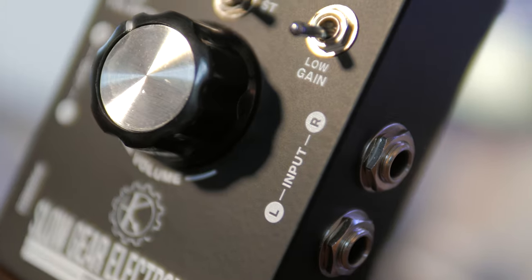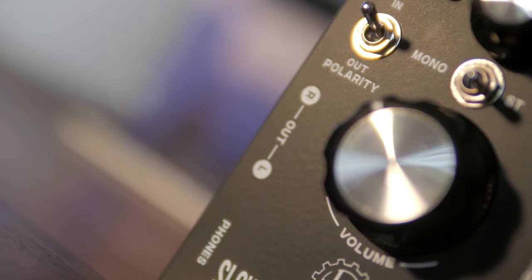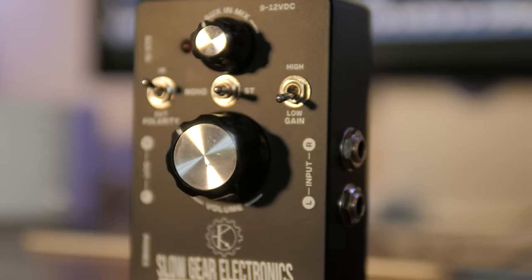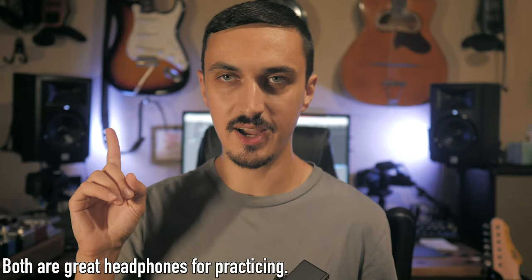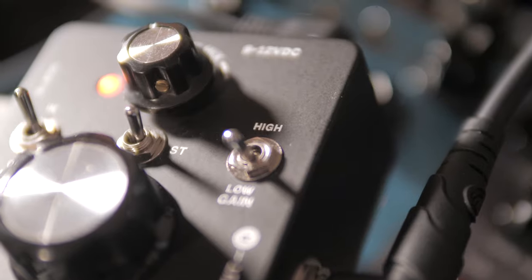We have high and low gain — this is for the headphone amp. Certain headphones are much higher impedance than others. Something like the Audio-Technica M40 or M50 series — those are pretty low impedance, so you would run this on the low gain setting, otherwise the volume knob is sitting all the way at minimum. Some headphones, like my 250-ohm Beyerdynamic DT770s or my 300-ohm Sennheisers, take significantly more output. Whatever headphones you have are going to work fine, in-ears included.